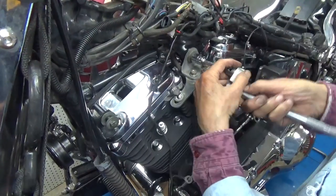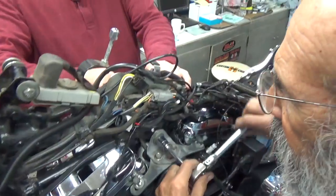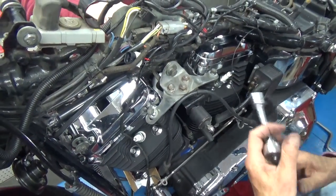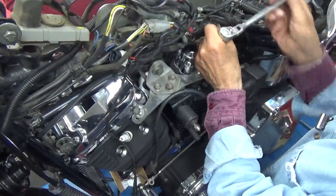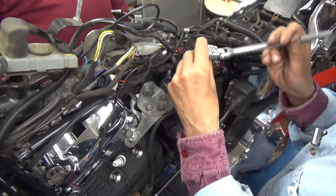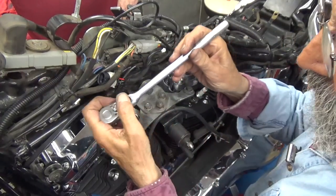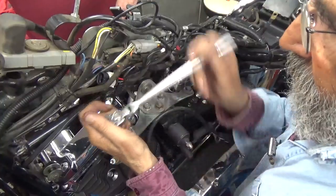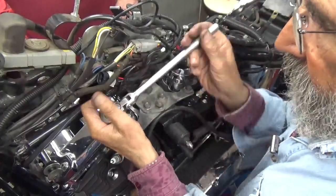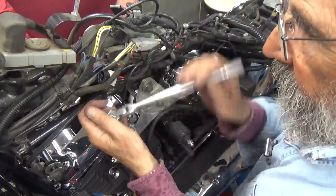Can you see it coming through there yet? Okay, I'm going to put it in place like that, and then tighten these down gradually. That's a big bolt in the middle there. It's about a 7/16 bolt with a 5/8 head on it. These out here on the ends are 3/8 with 9/16 heads. Just kind of standard hardware. Thought I had it down.